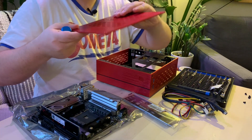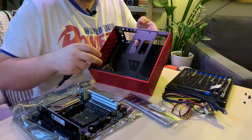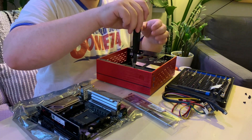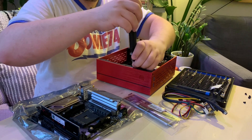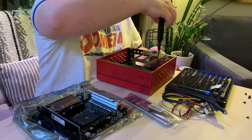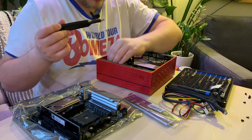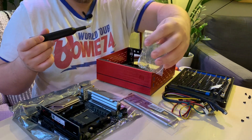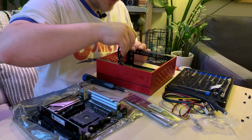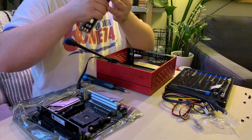The top is just a billet aluminum plate that you can just take off. There's a hard drive mount here that you can use for a spinning disk hard drive or SSD — like a 2.5 inch or 3.5 inch — but I'm just going to be removing that because I don't need it for this build. It's removable for setup and installation as well, so nothing permanent. Just taking that out, taking out the screws that came with the case, and pulling all these cables out of the way so we've got some clear space.